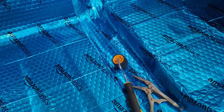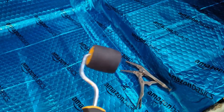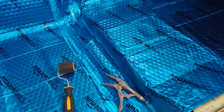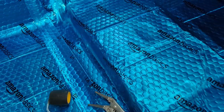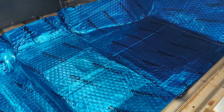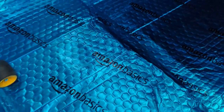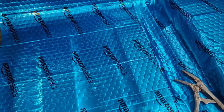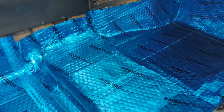One side is almost done — three and a half sheets of this Amazon Basics butyl adhesive-back stuff with a foil backing. It sticks really well but you'll need a roller to work it down good. I put it out in the sun — that helps. I paid about $54 a box for this quite a while ago. At the time Kilmat was around $120, and now this Amazon stuff is $119. I'm not bashing Kilmat at all — great product — but this was a bit less expensive and it works just fine for this car.